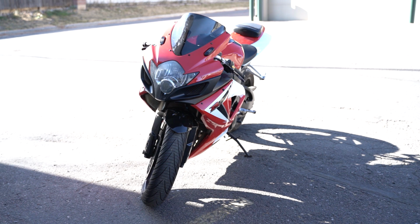When I figured that out, I was like, okay, master cylinder, it's not even the caliper. I drained the brake fluid while I was at it, so I replaced the master cylinder and did the brake fluid. She's braking perfect now, both sides, everything's good. Pads as well. Did the antifreeze flush and change, and the oil change. I run Rotella T6 on my slipper clutches, especially my Gixxers. I just like it. I change the oil every 1,000 to 1,500 miles. You don't have to run that. That's just personal preference.